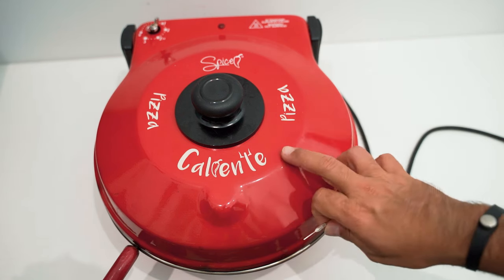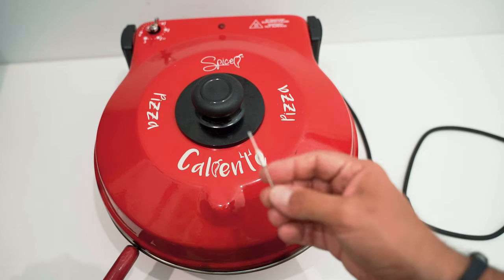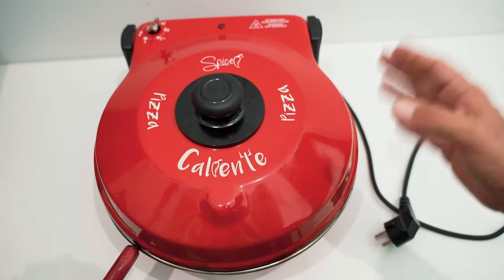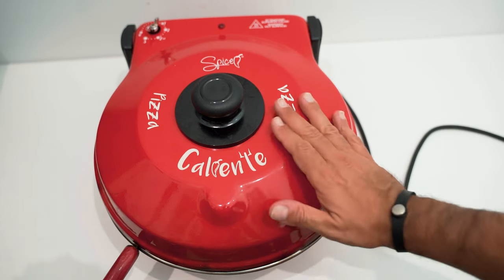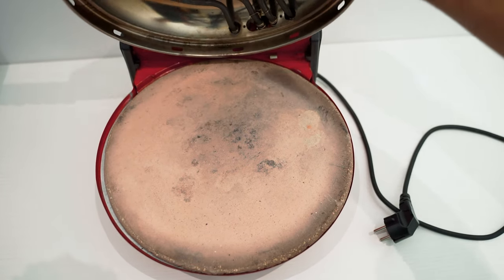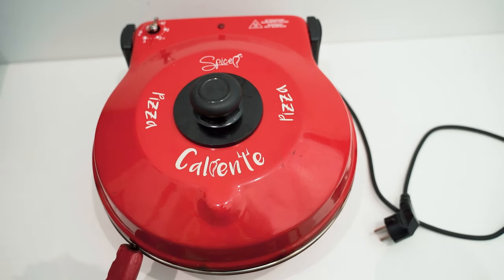In case you guys don't know, it's basically a safety device which opens the circuit against overheat. So the default one you can find in this type of ovens is 240 degrees, so this one is more powerful, 300 degrees. Usually if you put all the cables and the thermal fuse on the bottom section, there shouldn't be any issues, but obviously on the top here we have the two thermal resistances, so that's where most of the heat will go. And so I simply need a more powerful thermal fuse. All the cables will remain isolated so that we don't have any issues with overheating the electrical cables. Now let's open our oven.